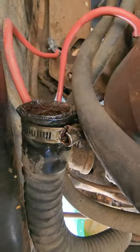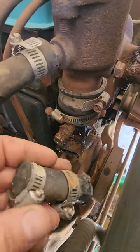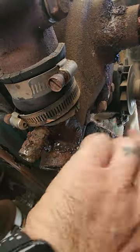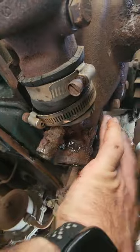I was able to get off the lower hose, which is clearly aftermarket. It had a dead end on it — you can see right here — but that's what somebody had done somewhere during the 75 years it's been alive. Now, the three water pump bolts are here, which are nine-sixteenths — one here, one here, and one there. So we're going to get that off now.